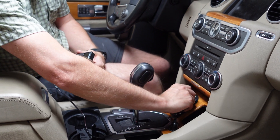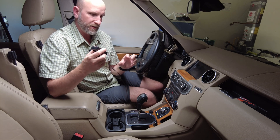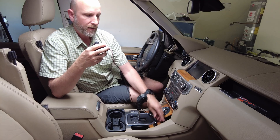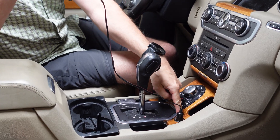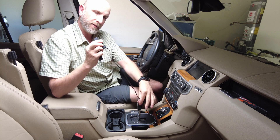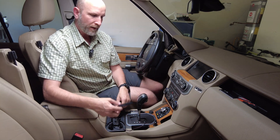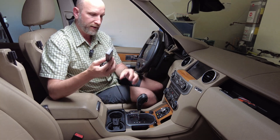I've chosen to put it right next to my mode selector dial. What you need to do is cut the cable for the control module — right now it's plugged into the cigarette lighter adapter, so I'm going to permanently wire this into the power cable for that adapter. This turns on and off with my ignition switch but there won't be a dangling cable. I haven't seen any videos on how to do that, so I'm going to show you how to rip out the center console and wire this correctly so the polarity is right and you're not putting anything in danger.